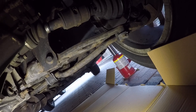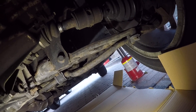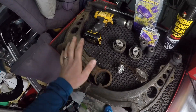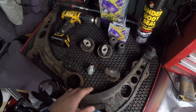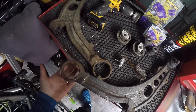It's a little bit late in the evening here in Dublin so I'm going to get started before I lose too much light and I'll get back to you when I have it all out and sitting on the bench. It's the next day - as you can see I got the wishbones removed and I've already got the bushes out of both of them. Very simple to do - I have a bush removal kit where you put a cup on, it's got a washer on the other side, you put the bar through, tighten up, and as it tightens it pushes the bush out into the cup.